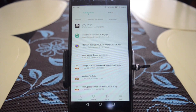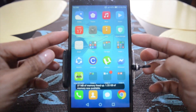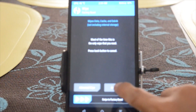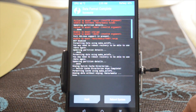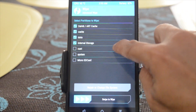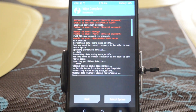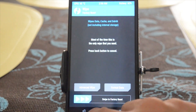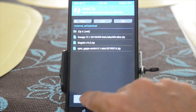Let's turn off the device to run the recovery. We are now in the recovery. Let's go to Wipe Format — yes, that's successful. Then let's go back to Advanced Wipe, check all partitions except the micro SD card, and swipe it again. We have a successful wipe.